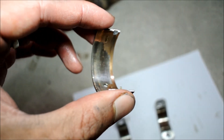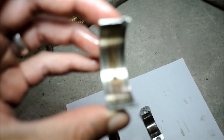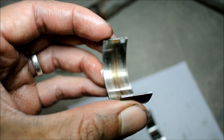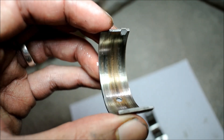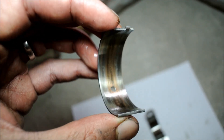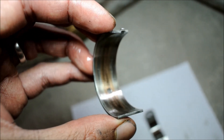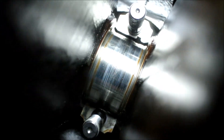If you see this, it means your rod bearings are busted, and this is what was causing the knocking noise in my engine. The copper layer from the rod bearing has been entirely scraped away. That was my number four rod bearing. My number one rod bearing looks a bit better but this is still very bad - there's obvious scraping and damage and failure on the rod bearings. This usually means grinding away your crankshaft and replacing all the bearings.